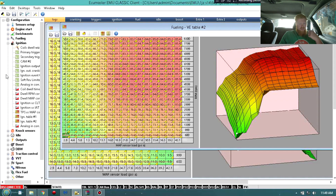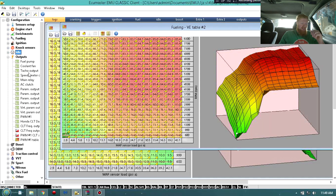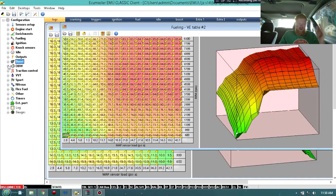Idle is kind of important, but I don't have an idle air control valve, so I actually set my idle with the throttle body manually. These outputs are for anything that you have - so a tachometer: you can run the tachometer output that is on the ECU and it will actually display to your cluster, which works really really good. Same thing with the fuel pumps - fuel pumps can be turned on with a ground signal from the ECU to turn it on in the back. Drive-by-wire I deleted - I've always had problems with it, so I just deleted that by using a non-VVTi throttle body. Full mechanical throttle body now.